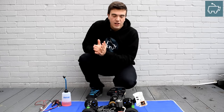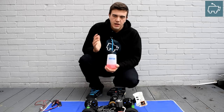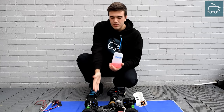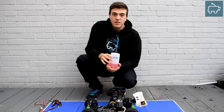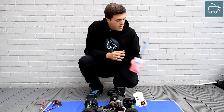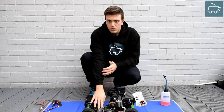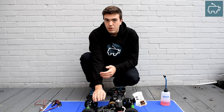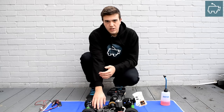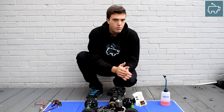The basic tools you're going to need in order to start the engine are just the usual ones. Obviously you're going to need some fresh nitro fuel. This is the first point I need to make: if this fuel has been sitting in here since the last time you used the car, it's very important you pour this away. Nitro fuel does go bad, and even if it visually looks okay I would advise using fresh fuel. That goes for what's in the tank as well. If it has turned to jelly in there, you will need to remove the fuel tank and rinse it out with hot water, making sure you remove all the water before you refill it with some fresh fuel.